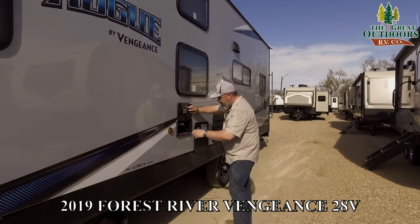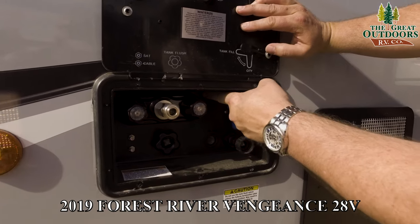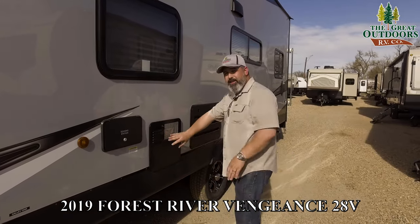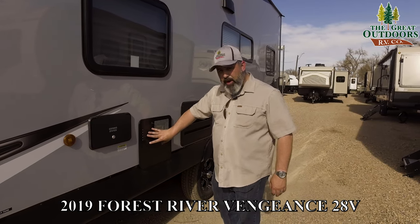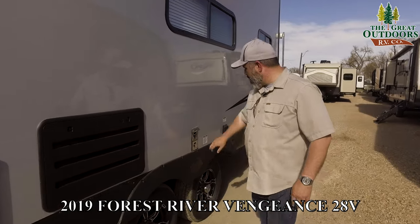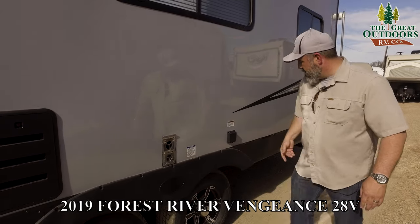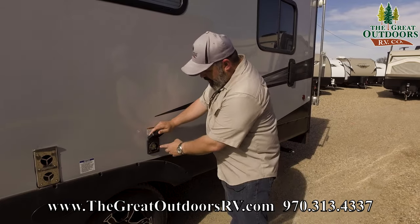This is your docking station. You've got your freshwater sprayer, your freshwater fill, and you can also flick this over for city fill. You've got your blackwater flush and your cable and satellite input. Right here is your six gallon water heater — this is gas and electric with a recovery rate of 10 gallons per hour. This is your exhaust for your refrigerator and also a service panel. You've got your exhaust for your furnace — always try to put a screen over this for the bugs. Right here you've got your 30-amp hookup.